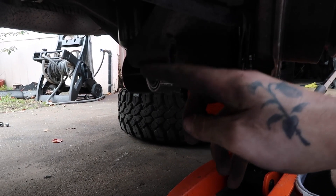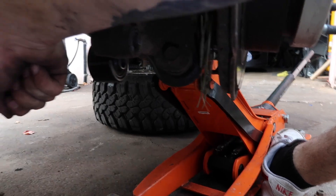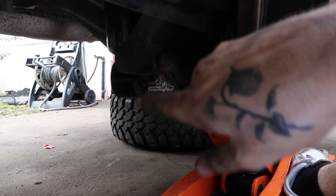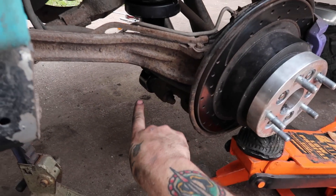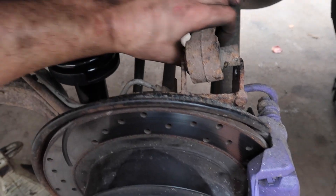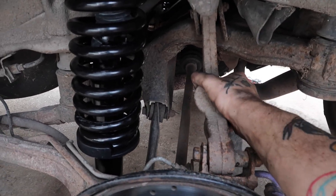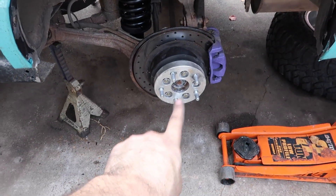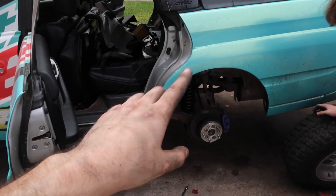You can see this is not lined up with this, so you have to get it as close as you can with the jack and then use the bolt to lever it, then bolt it down. The tip of the bolt is barely in, so he had to push down on the knuckle while I pulled the bolt over to get it to line up. You can see how much tension this is under, but it is solid. We just had to jack the bottom of it up and use a screwdriver to line it up, and then finally hammer it through. Rear shocks are now complete.